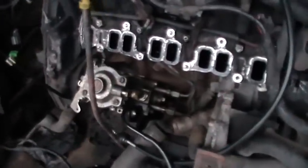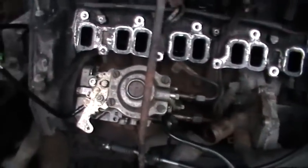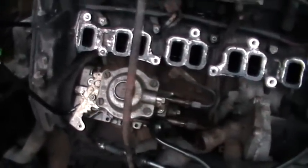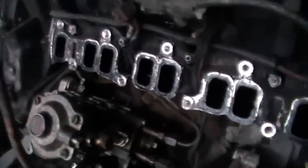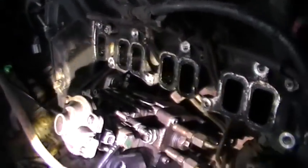It's a lot easier to see on this one than on the rear wheel drive one, and it's a lot easier to fit as well. There's the pump — you can see it bolts straight up onto the flange. We've got our top hat bushes in there. I'll get the torch on that so you can see it better. You can see there's a bush in there — this adapts the PCD of the pump to match the back plate.